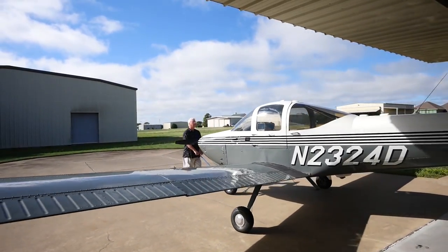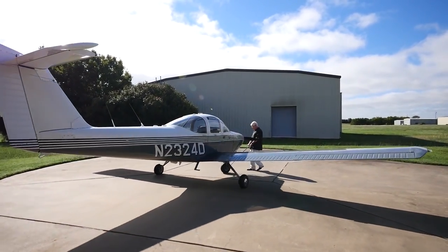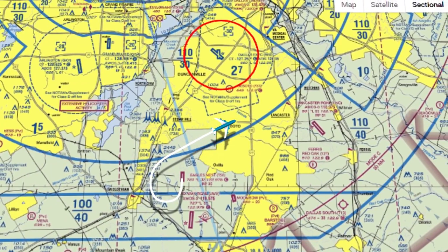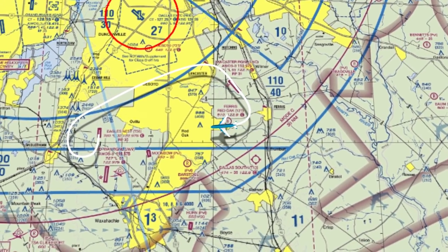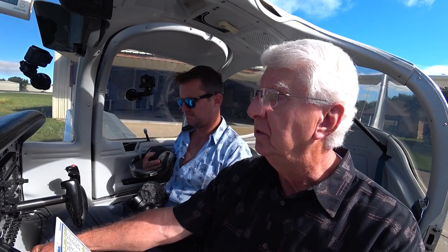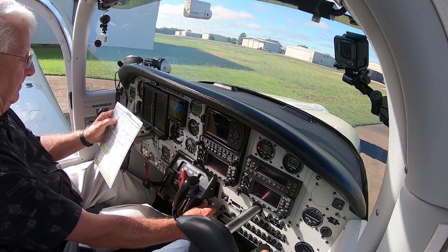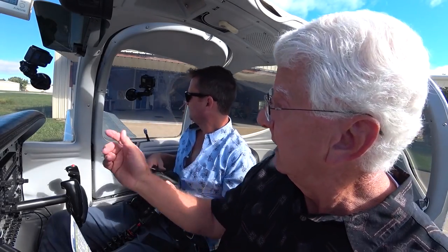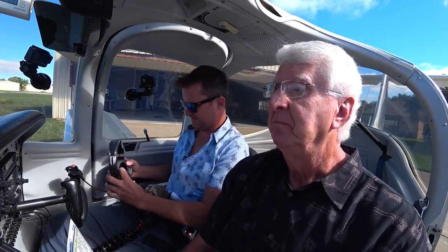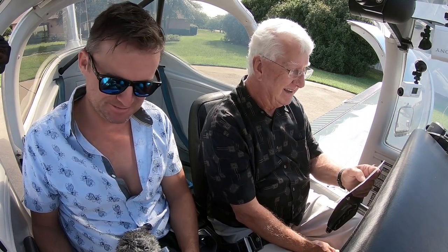One of the great things about a small and light airplane like this is just how easy it is to pull out of the hangar. The plan for the day was to fly east out of Eagle's Nest over to Lancaster where we had lunch, and then a quick flight back to Eagle's Nest. The mixture's full rich, and I'll shoot just a little squirt or two of prime to it. Brakes are parked, propeller is clear, and my tow bar is right over there leaning up against the chairs — that way I know I'm not starting with the tow bar on, which would be a very expensive mistake.